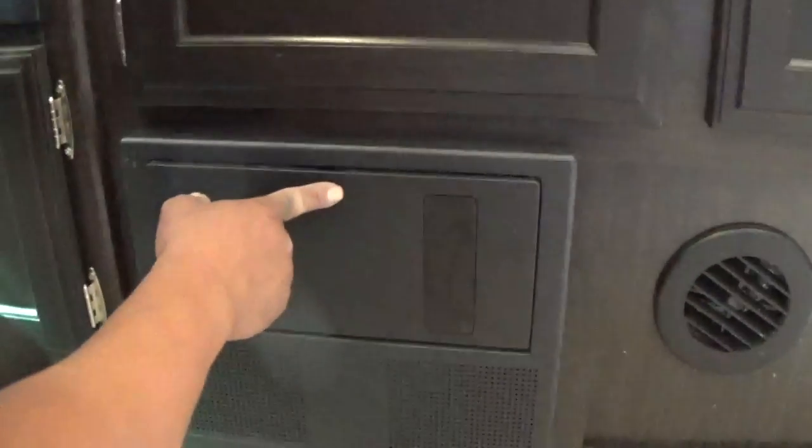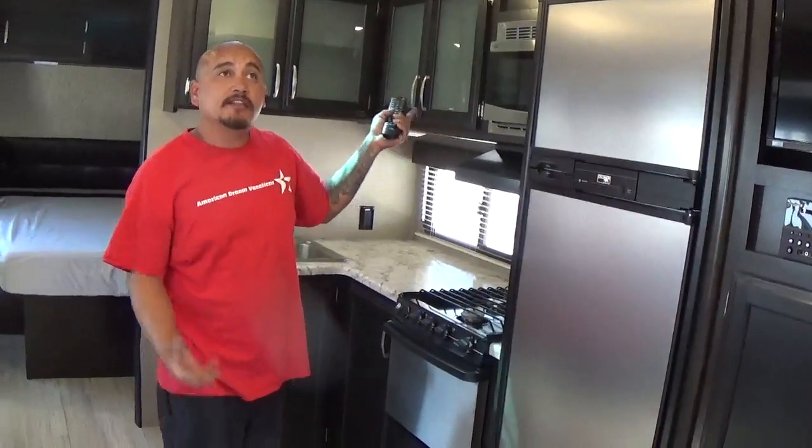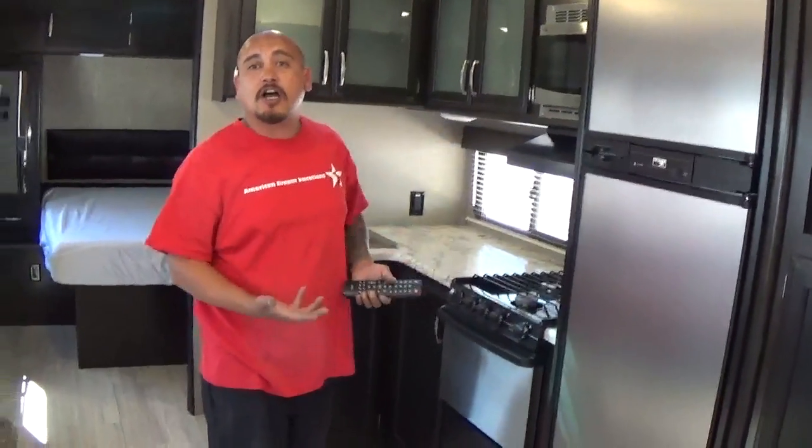Okay? We do recommend that if you do have your air conditioner on, you only use your air conditioner. If you're going to use your microwave, turn your air conditioner off. Use your microwave. You don't want to run both at the same time because that could cause power issues.